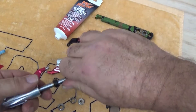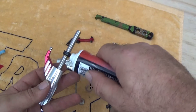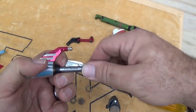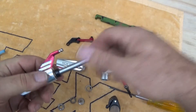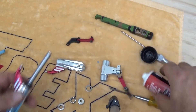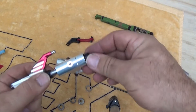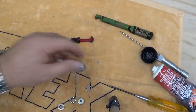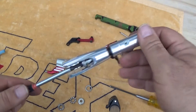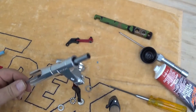I am going to want a little bit of synthetic lube on the shaft itself where the damper runs. Spin it around a little bit, and I'm also going to want just a little bit of synthetic lube on the outside of the damper just to put things together easier — it's going to come in from this side. I'm going to use my large driver here, go ahead and bring this whole thing through. This uses a four millimeter.